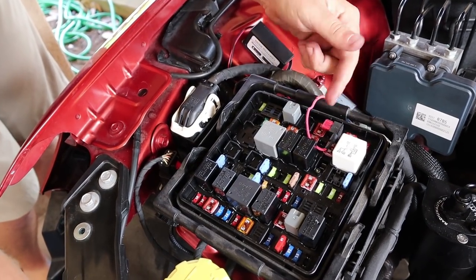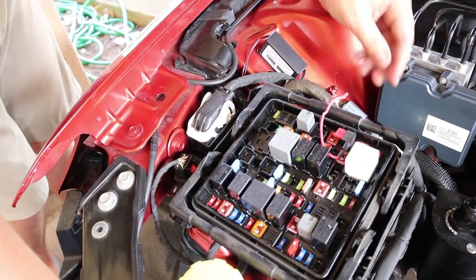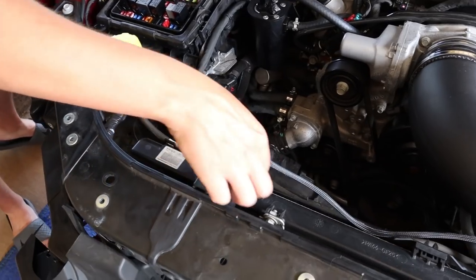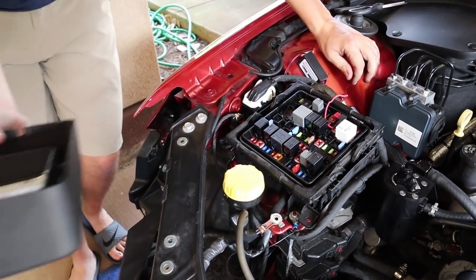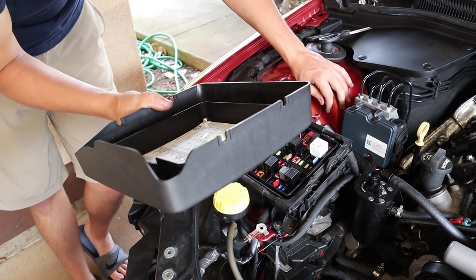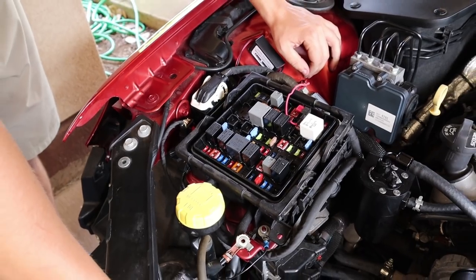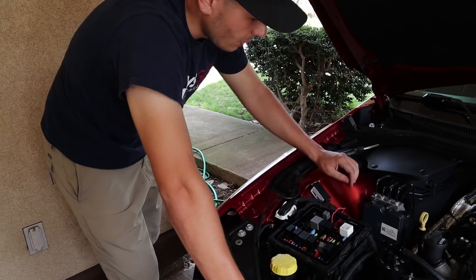We got the fuse tap right here — it just has the top fuse in it since it's an empty fuse slot, so we're good there. That loops around into its power line. I took the ground from back here, it goes into the Bluetooth controller, and the cables going to the harnesses and drivers run down here. One driver hooks up to the headlight here, the other will have a cable that zip-ties across underneath. For the remote tie-ins I plan on tapping fuse 63 or 64 — those are the HIDs. Maybe they'll turn on once the relay kicks on. If it doesn't work, I'm pretty confident I can shut off a light before turning the car back on. It is a cool safety feature, so we'll try it.